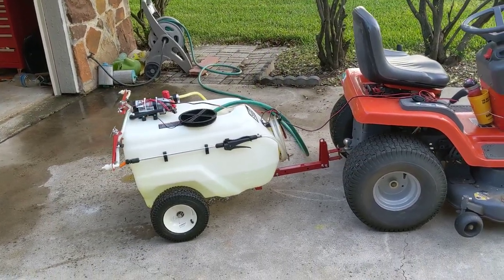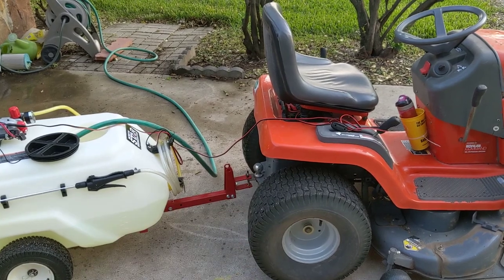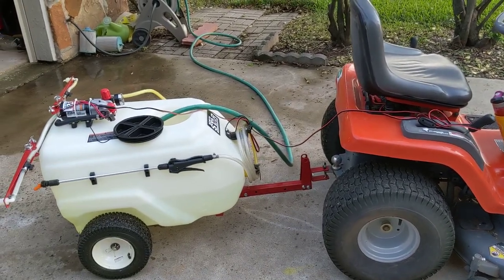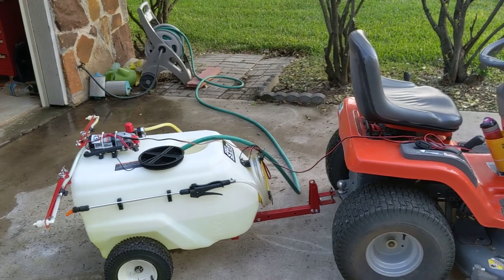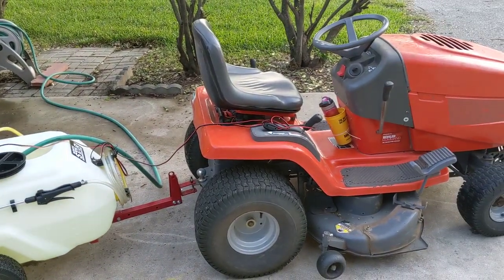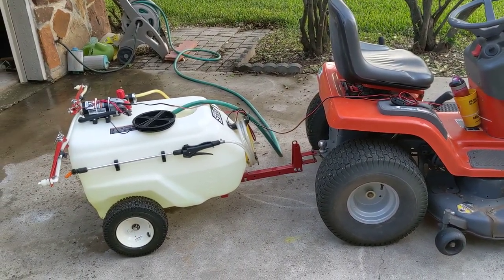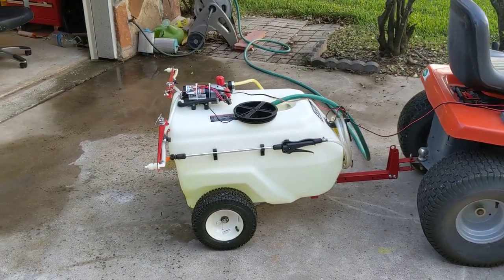The camera battery died on my phone, so all I had left to do was put the hitch on — I have it sitting up just slightly so it runs to the back where the pickup is. I greased the bushing and the wheel hubs. Both of them have grease fittings and they were both finger tight, so tighten them up. I did some wire cleanup with zip ties. I'm using a little lawn and garden battery on this riding lawnmower — so far it's working great. I started running the RPMs full blast even if I'm not going fast, since it's got a little magneto charger to help keep the battery up. I've probably got a half tank of water — going to slosh it around and hose this thing out. See ya.